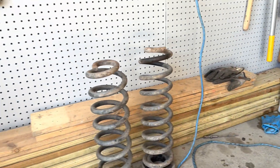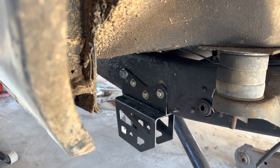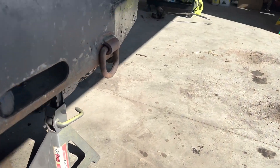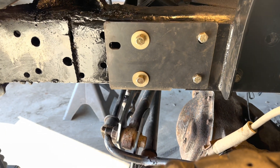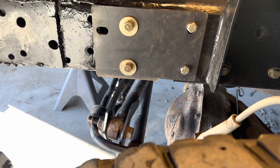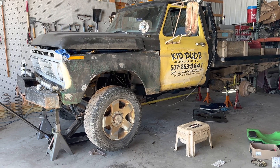I'm going to put on the coil springs and let most of the weight sit on the axle after I get the radius arms bolted in, because that'll get me lined up closer. Once the coil springs are on and most of the weight is sitting on it, we can figure out where the drag link — or whatever that arm is called — is going to be. We've got this bracket loosely bolted in place, and that bracket down there is just going to sit right between those two bolts. We'll put a couple tack welds on it, remove the bracket and bolt, and burn it in. Still got to do the rear axle — that one's extremely easy.